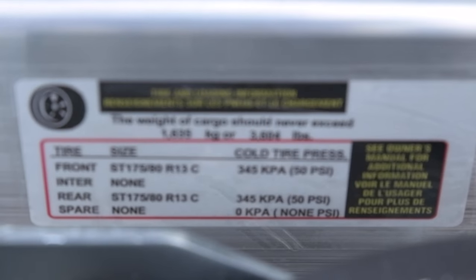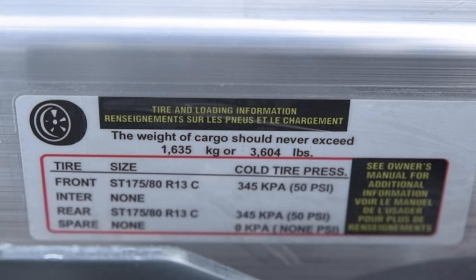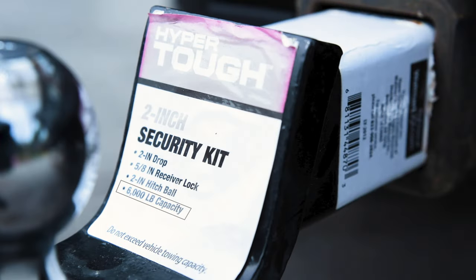Towing Vehicle: You need to start off by checking that your tow vehicle has the proper towing capacity for your boat and trailer. Check the vehicle owner's manual to determine the gross combined weight rating, GCWR capacity, which is the weight limit for the combined vehicle, loaded trailer, and people and gear in the vehicle. A professional scale like those at a truck stop will determine the exact weight of your boat and trailer. Also make sure your trailer hitch is rated for the weight of the boat and trailer.